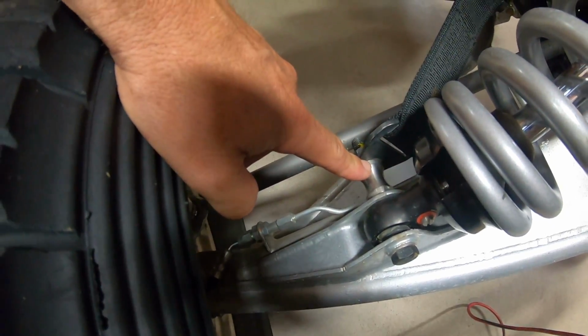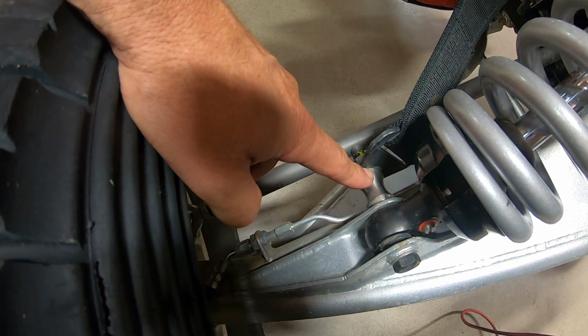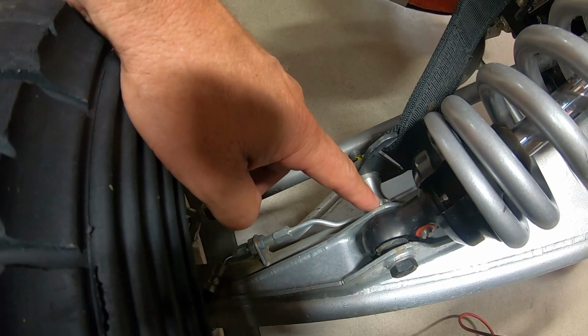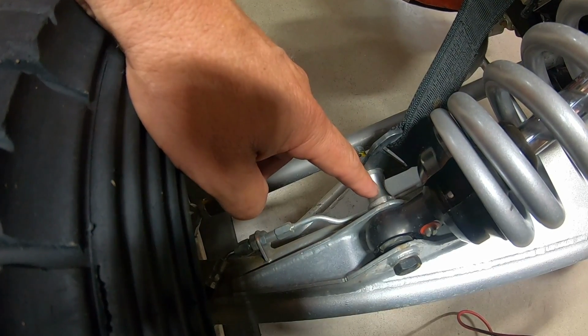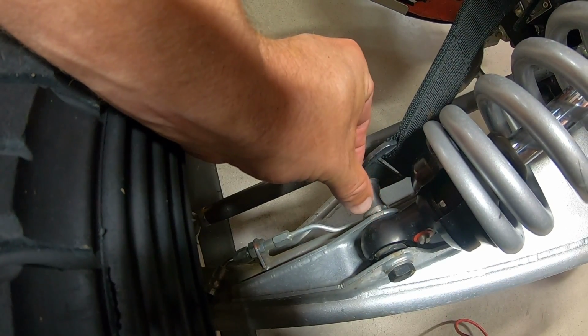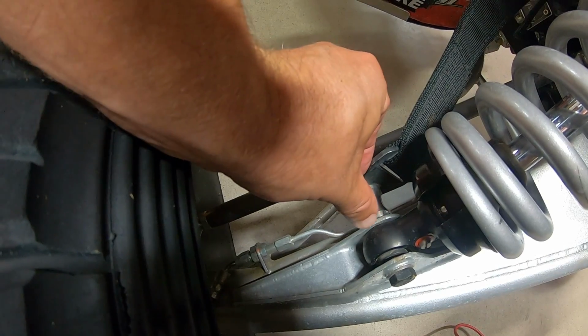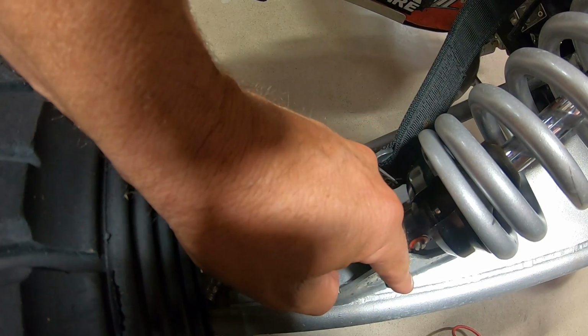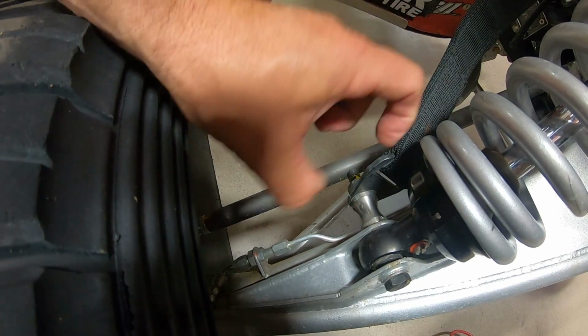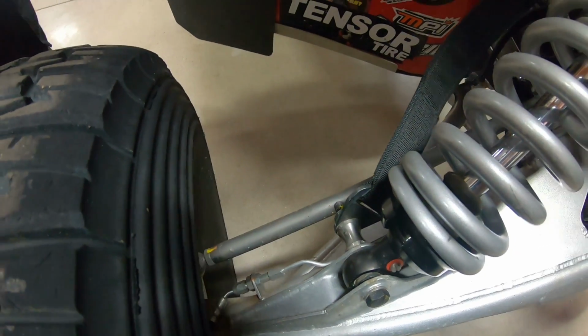This is a stainless steel spacer on the bottom that we supply with our straps. This stainless steel spacer is 1 inch in diameter. The reason that's important is because a lot of people supply straps with an aluminum spacer that's 3/4 of an inch in diameter. Well, that aluminum gets crushed, that aluminum will bend over side to side and it'll bend the bolt. So we do a high grade stainless. It's a lot stronger and a larger diameter, so it can't bend.